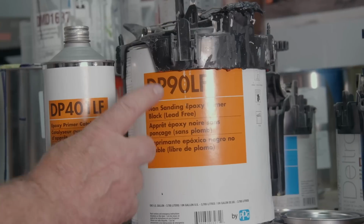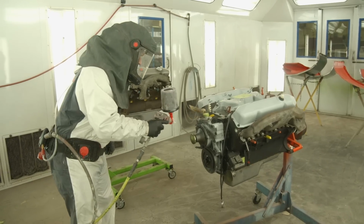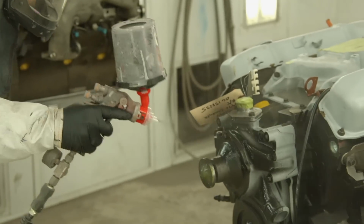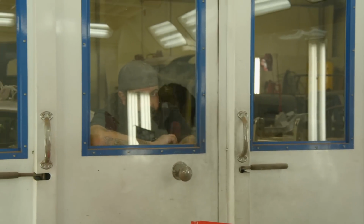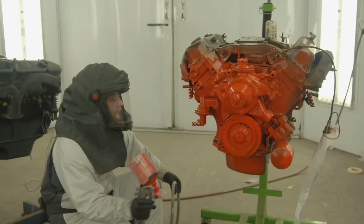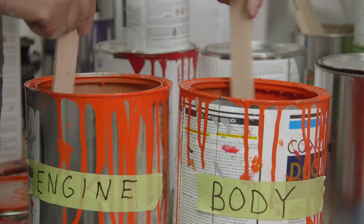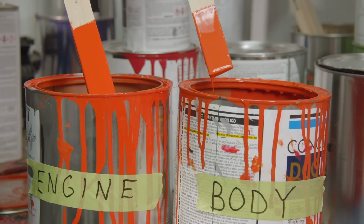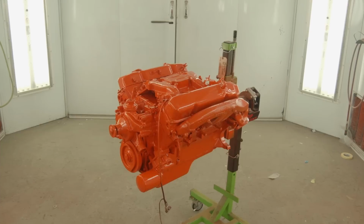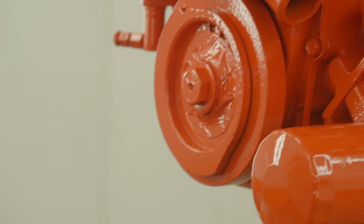Noah jumps in, DP90s it, because paint won't stick to metal without the DP90. I have the paint mixed up already, just because we haven't gotten to that point yet. So he just goes in there, DP90s them, paints them, and then we're good to go on those. Then it's about three coats of the single stage, and we spray the Hemi Orange on it. We have a special Hemi Orange on these. So we mix it up, we just hold the metallic out of it. You know, all the Hemi Orange cars we do has that metallic in it. On these, it's not supposed to. So we actually have a batch made up, ready to go, no metallic in it. Three coats on these, and then they're done.